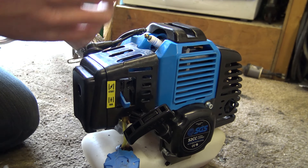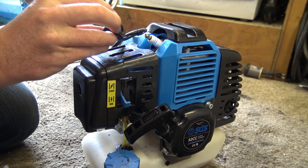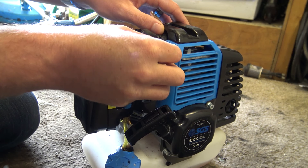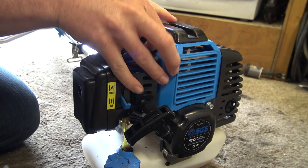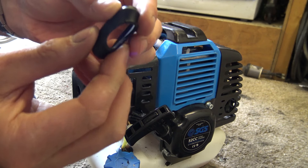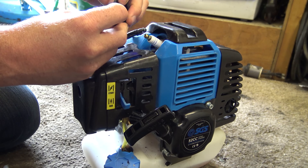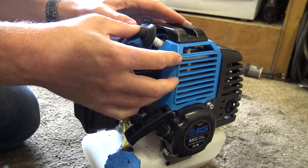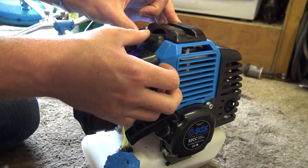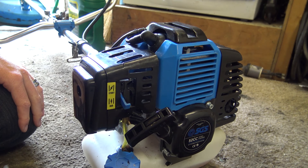Because this person is complaining that it's getting stuck, we'll take that measure anyway. Put the plug back in and tighten it up — don't do it too tight, just common sense tightness. There's probably a torque setting but we won't go into that. Stick the cap back on. I notice the wire on this one is going a bit brittle, which is strange for a strimmer that's only about a year old and been used maybe four or five times.